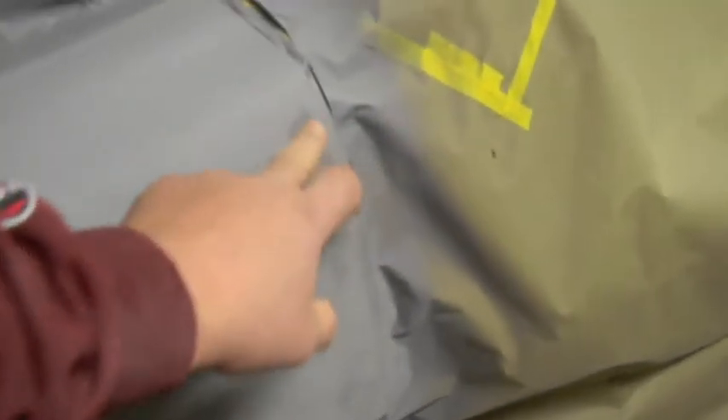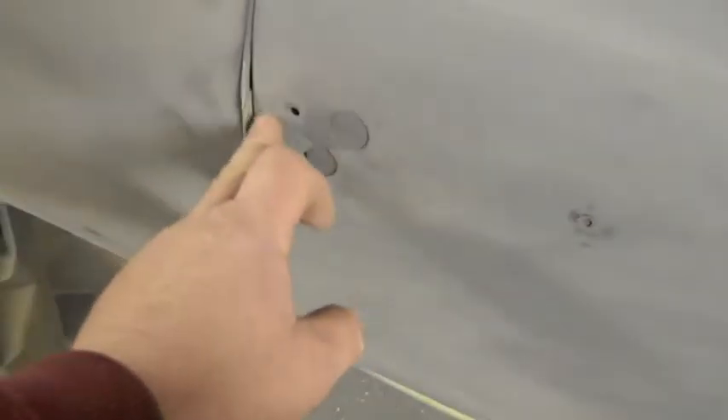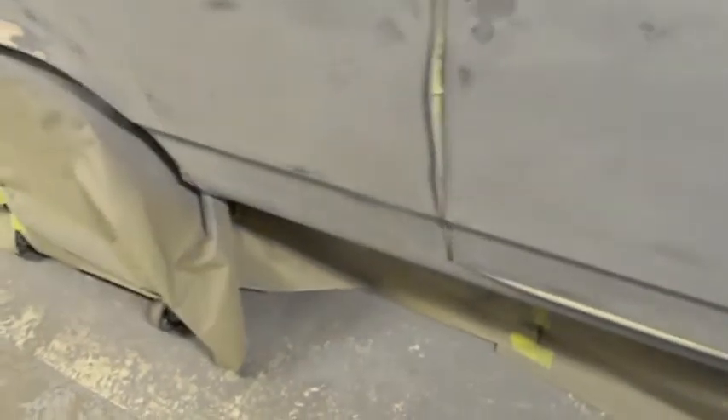This side — the door — is pretty uneventful. You can see some areas where I hit the epoxy, a couple little dimply things from when they pinched the door. The door is pretty much uneventful. The only low spot in the door is right here, which we talked about before, but the door handle covers that — the lock cylinder touches the door handle on these cars. So the door I'll probably get away with just recoating, blocking, and wet sanding.